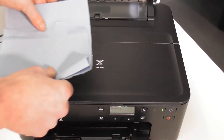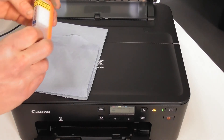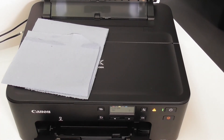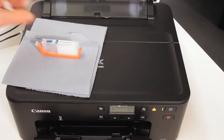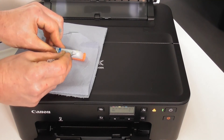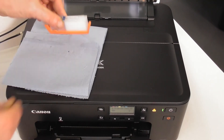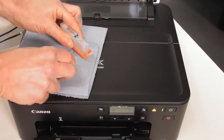Just put a piece of tissue down, or a bit of paper, or something. This one doesn't have the seal in. So I'm going to remove the yellow tape. If you don't remove the yellow tape and try to fill it, it takes forever for the ink to soak through. One thing I noticed is that when I remove the yellow tape — depending on the time of year — I could tell there was something, but it's clear. I just thought there was a bit of residue over the breather hole. So I'm going to remove the small flat plug, or the coloured plug, and that's your refill hole.